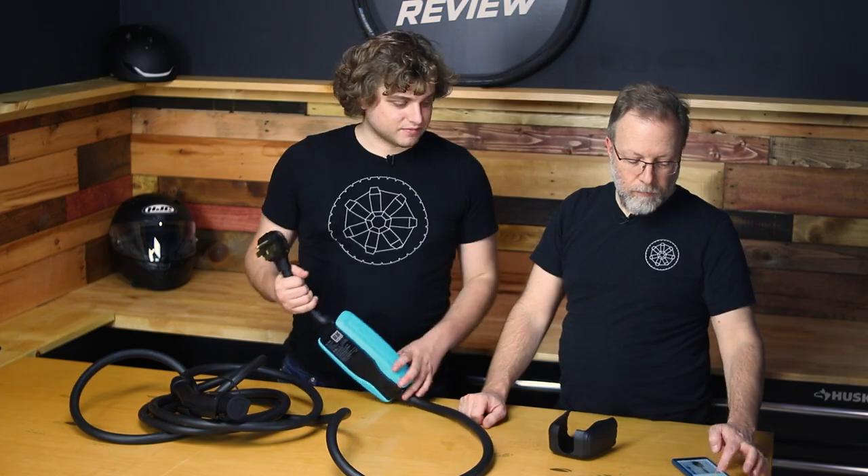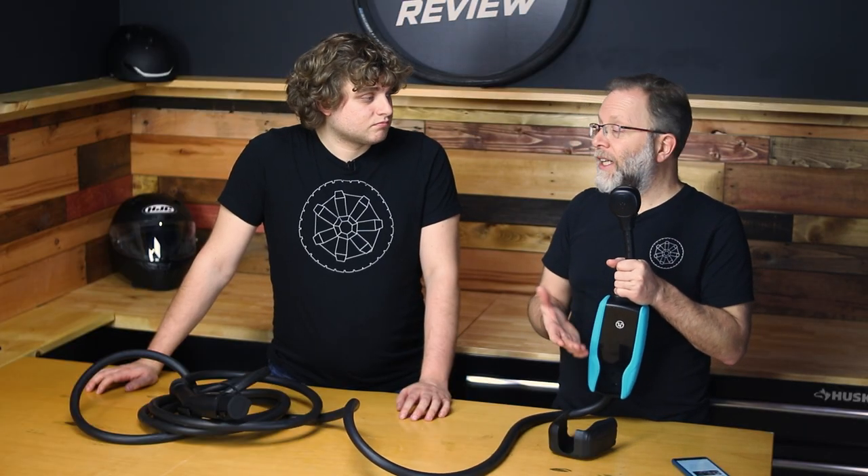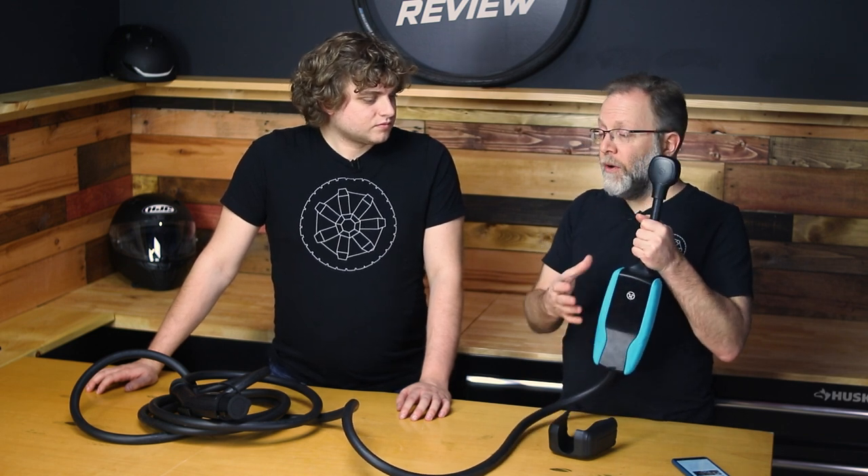Going back to this, the fact that you're going to be able to charge anywhere is kind of important. The 14-50 won't plug into everybody's outlet when you go to grandma's house, but the replacement 120-volt will. So that one time you need it, that one time you didn't make it all the way to the high-power charger or all the way to grandma's house, you'll be glad you had the 110 in there. The one thing that would make this better would be more replaceable heads — Pion should spend some time sourcing other 220 plugs that plug directly into this unit for say 20, 30, 50 bucks. Another thing I really like: on cheaper ones you have to push buttons to tell it what to do, but this one comes with a smart chip that senses what it can give from the outlet and gives you all it can give to your car, up to 32 or 40 amps depending on the model.